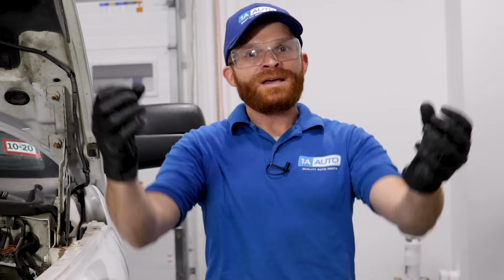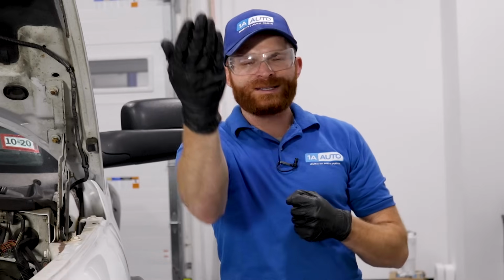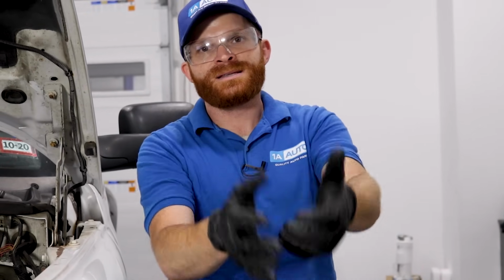And one last thing, once you've gotten your fuel pump in, on the initial start you might happen to notice that you have a long crank of some sort, and it might be a little bit worrisome because, well, I thought I was fixing the long crank. Something you need to think about is that when you disconnected those lines down low, there was an opportunity for the fuel that's up inside the fuel lines to make its way down, so it's potentially putting a lot of air into the system.